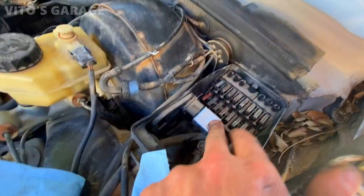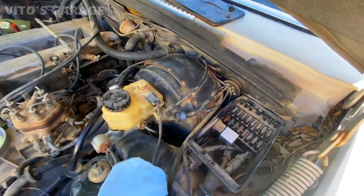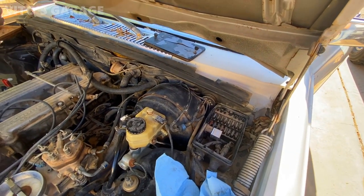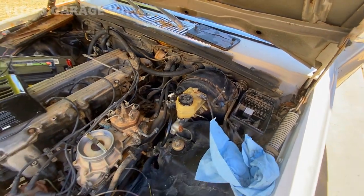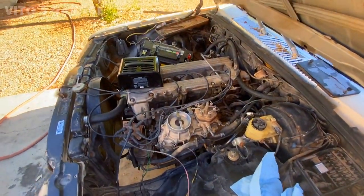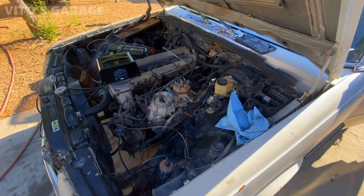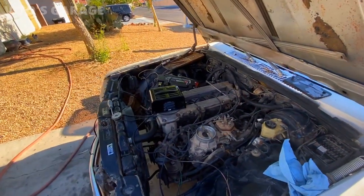Okay, so we installed a different good fuel pump relay, but we still have issues with the fuel pump. It's working, but it feels like something is restricted, so the pump is having a hard time pumping the fuel in the back. So we still have to figure that out, but as of right now, we're gonna show you how this thing starts up with the starting fluid. So we have spark on it already, and go ahead, connect that battery really quick.